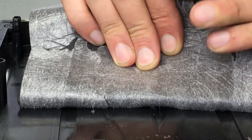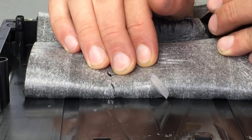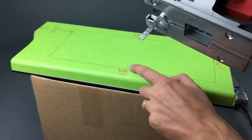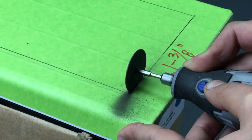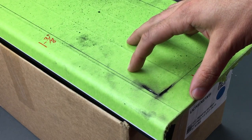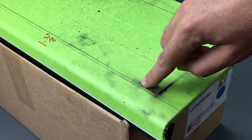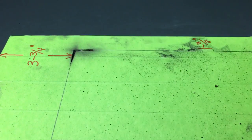This is definitely the most tedious part of this mod, but it must be done. Before I can use the jigsaw, I need to use the rotary tool to make an incision cut for the jigsaw blade — it's blunt, so you can't start a cut with it directly. I'll use the rotary tool to make incision cuts in each corner. The dual-layer material in the H440 bezel took a long time just to make these incision cuts, so if you plan to use your rotary tool to cut out the entire opening, it's going to take a long time. Once I've made incision cuts in each corner, I can use the jigsaw to make the long cuts and cut out the opening.